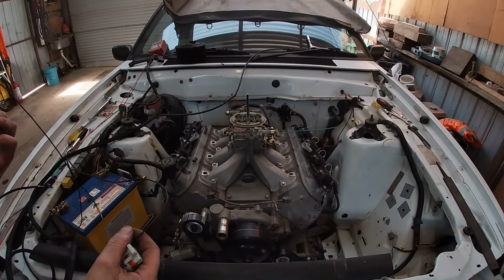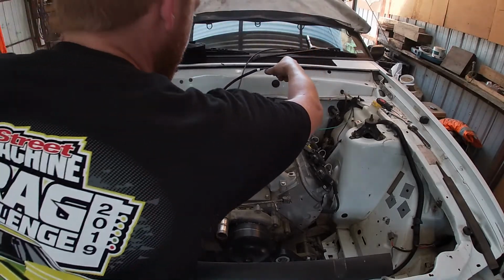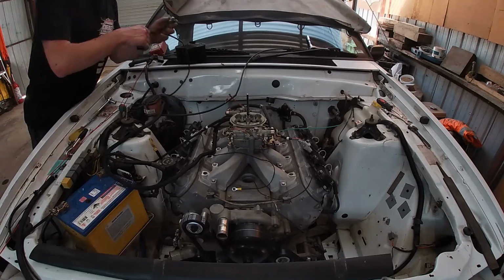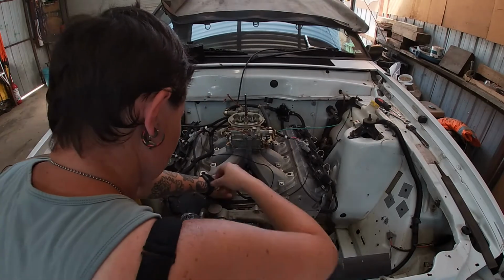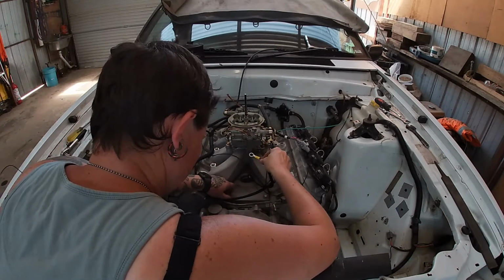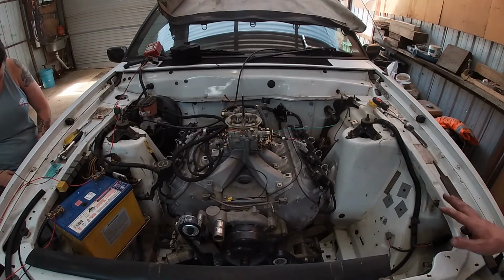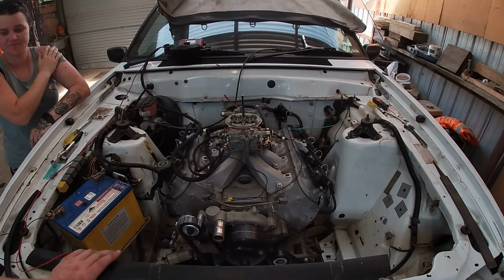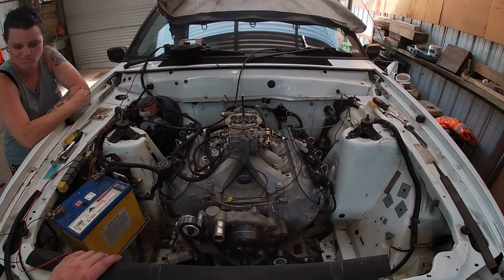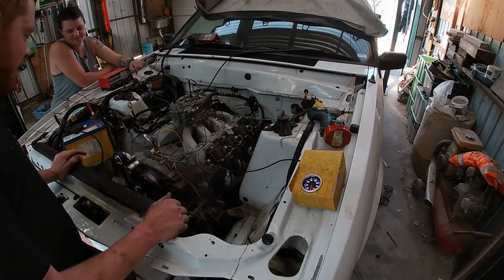All right, driver, I'm guessing that's the American driver. That's ignition wire. What we've got to do is put them two together, and when we want to stop it, we've got to pull one of them off. So now we need to put power to the starter motor, and that's it. It'll start, I think. Awesome. All right, we've got the fuel pressure gauge wired up, MSD's wired up, we've got some wires for our starter.